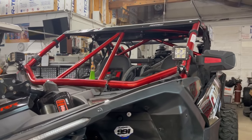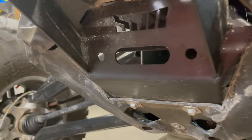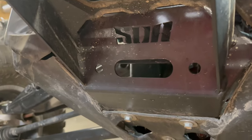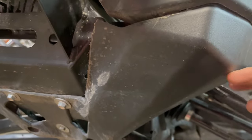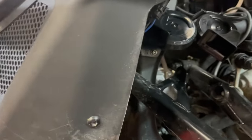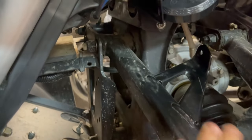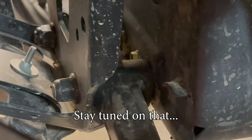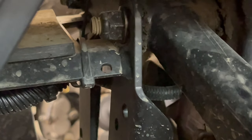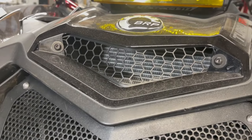Starting with exterior hard parts. First, I have the SDR Baja bumper. There's room for a fairlead with a winch in there. It replaces the whole bulkhead — this is just the plastic piece right here — and it braces these front arms. The stock one adds a little double-shear bracing to the arm bolts, but this one helps a bunch. Definitely recommend doing a bumper that replaces the whole bulkhead. Up here I also have an aluminum grill on the upper section.